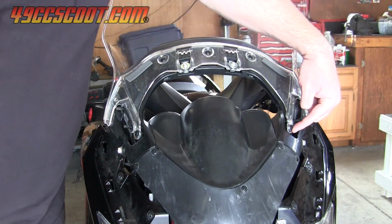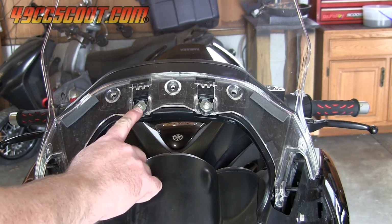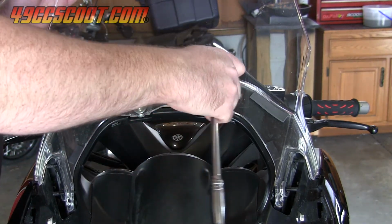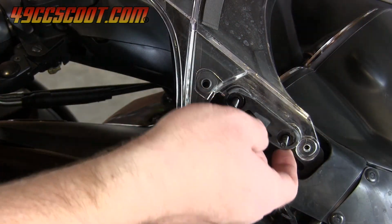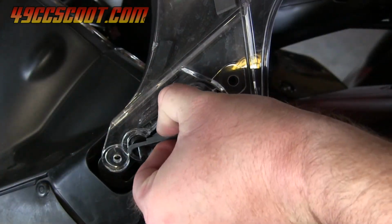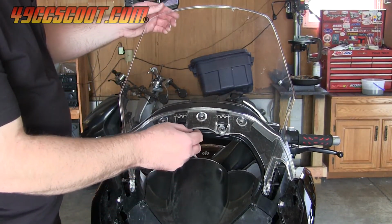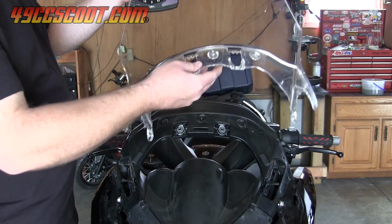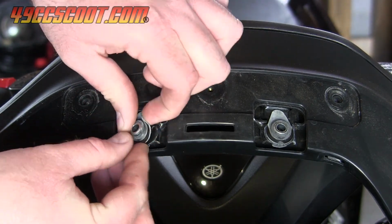Five plastic screws and 2 bolts held the clear shield in place. The bolts required a 4mm hex key. There were rubber pieces on the mirror mount that I pulled off because they sat on top of the shield. With all of that gone, I removed the clear shield. I also took out these 2 pieces that aren't needed without the shield.